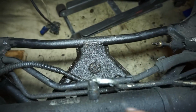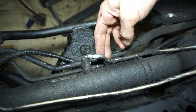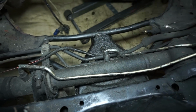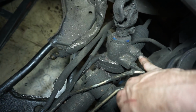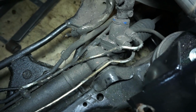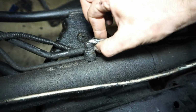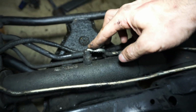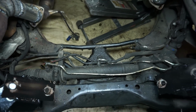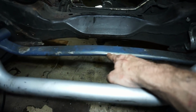You can see it did some work here on that power steering line. Kind of scrunched it a little bit. But I'm going to try to pull that back up. I might actually just replace it. It's just a line from there to there. Maybe I'll just do that. That's probably going to be easier than having to worry about it. Doesn't look like it's too bad, but it is kinked. So that was just from the pan that was hanging down. I didn't realize the pan was hanging down. But anyways, I also have to bend this back down.